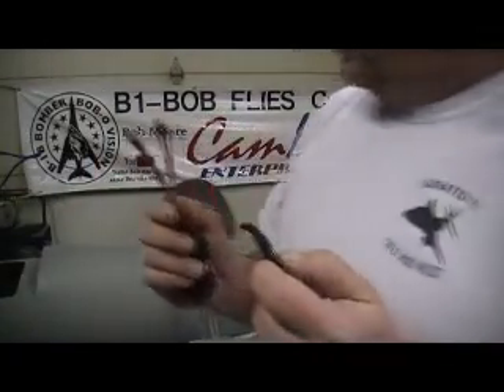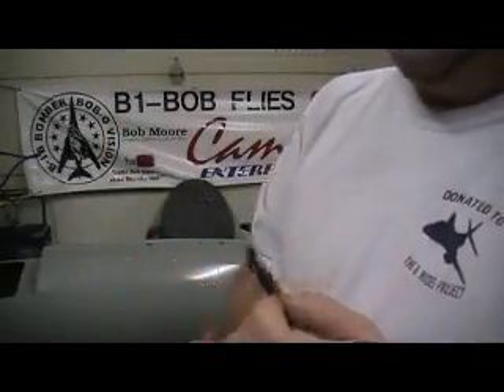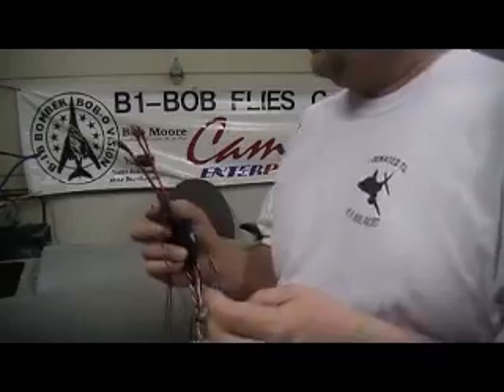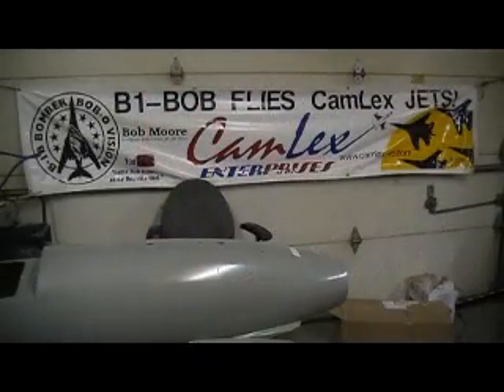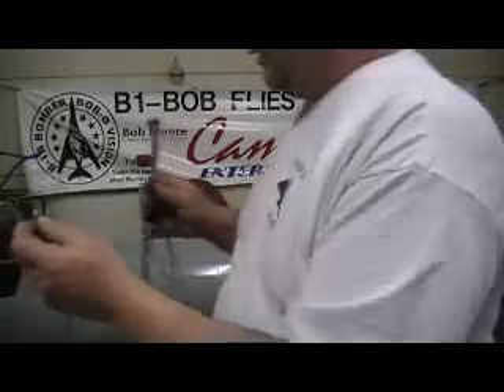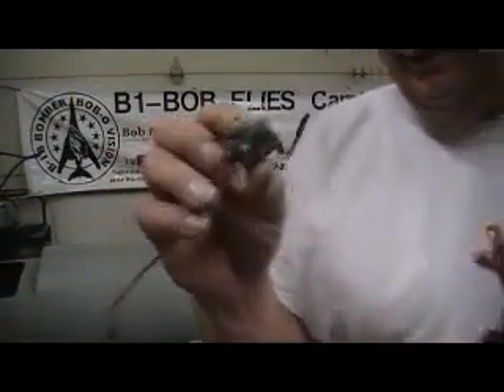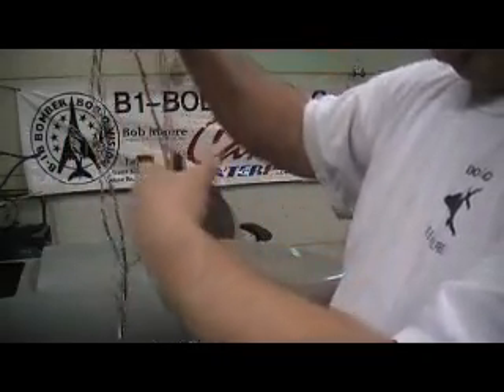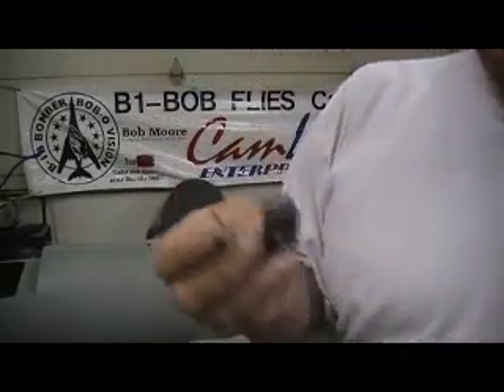You put these satellite receivers throughout the airplane. These receivers don't go through thick carbon — they'll go through thin carbon, one layer of carbon — but not real thick carbon or metal. So you position these throughout the airplane. These receivers will get blocked off through the flight, just for split seconds as it goes through the fuselage and areas it won't penetrate through. This little thing here tells you how many hits each receiver has. If you've got one receiver that's getting blacked out way more than the rest, you need to move that receiver. That's what this does — it's a pretty cool little setup.